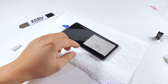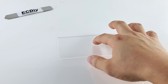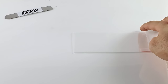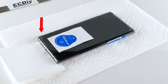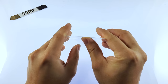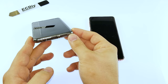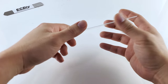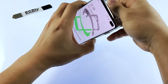Try wiggling it or putting pressure on it here and there to see if it works. You can check for form defects by gently pressing on the four corners, then flipping it and pressing in the center. If you feel the protector flexing or lifting on one side, you will likely experience an issue with the install or protector lifting after a day or two. Get a feel for how much or how little pressure it takes to flex — this is important for those wanting to use the in-screen fingerprint sensor, as I'll explain later. If you purchased from us and receive a defective one, just break it and send us a photo and we will send out a replacement right away.